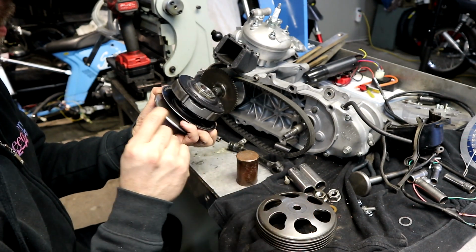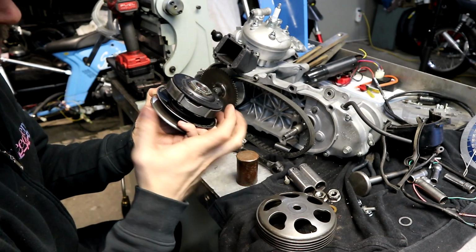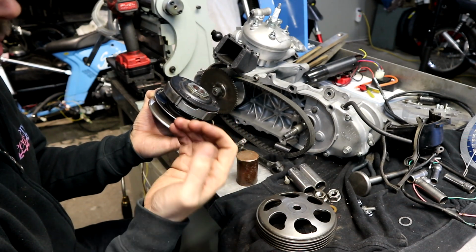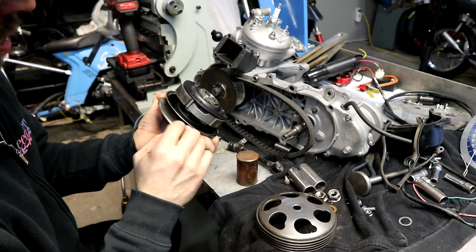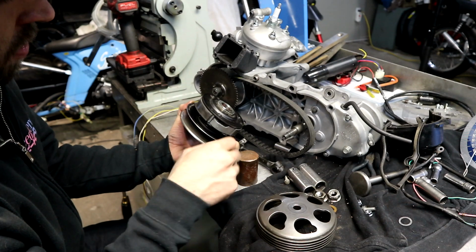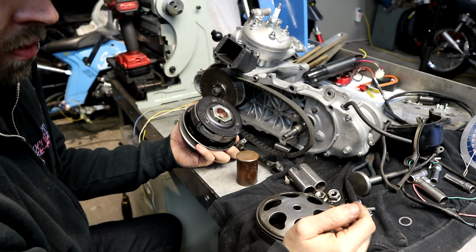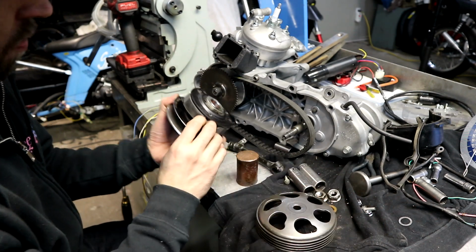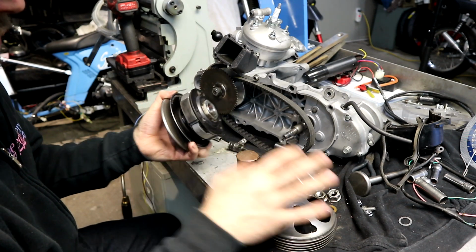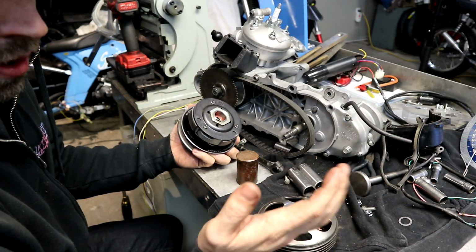If you run those weird Malossi yellow discs to allow the spring to slip so you don't end up coil binding, those can limit your travel as well. I make those out of Teflon rings. I just make tiny Teflon rings and put them on the bottom perch just to allow the spring to slide. It's way simpler and a lot smaller. It won't keep the pulley from fully engaging. So these are all things that are good to take a look at.